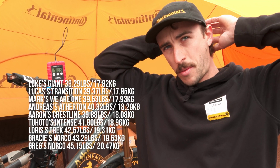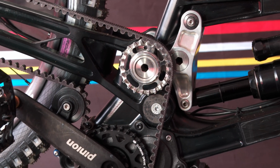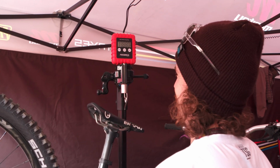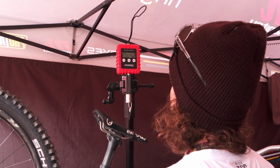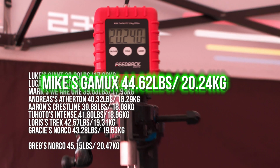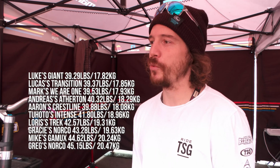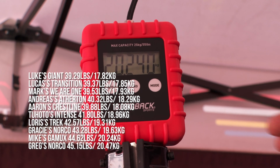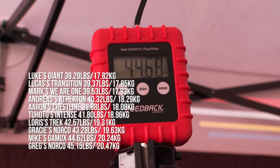How much is on there? Over 500 grams. We're about to weigh Mike Coulter's bike. It's our junior rider. Now I know how much it is. So, are you surprised at this? No, weight to us is not a real concern. For us it's important that it's in the right place. And for example, for flatter tracks like here, we might add a bit of weight down low in order for it to keep speed more. So depending on what we look for, we adapt.